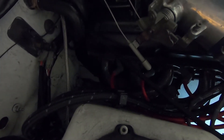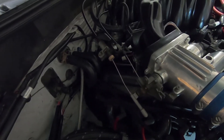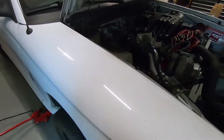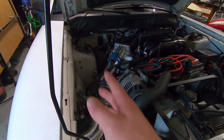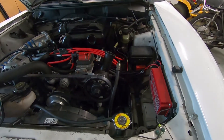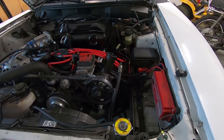I did put these braided fuel lines on and cleaned them out. When I cut the hose, maybe I missed a spot or clogged an injector. What I'm going to do is swap the O2 sensor to this side to monitor this bank and see if it is running lean. The exhaust on this side feels way hotter, and it's kind of breaking up when I get into it a little bit, and it's progressively getting worse.